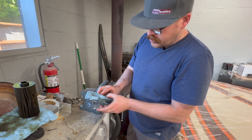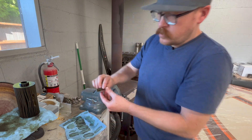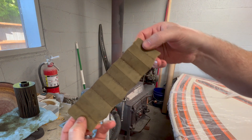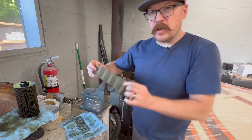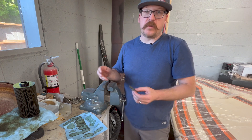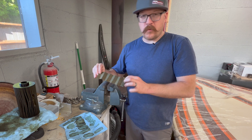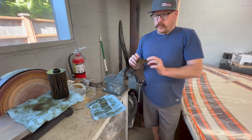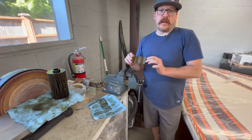You can see we got it all squeezed out, and the paper towel is pretty saturated. Now you can have a much better view of what's actually in there and how much metal you have or don't have. It's a pretty quick, easy trick. I don't have an example with a failed engine where there's a lot of metal, but I do have a little speckles here, which does not worry me in this case. On an engine failure, it's very, very obvious, or if you're really fighting one small thing on an engine, this really helps you narrow it down and pinpoint it.